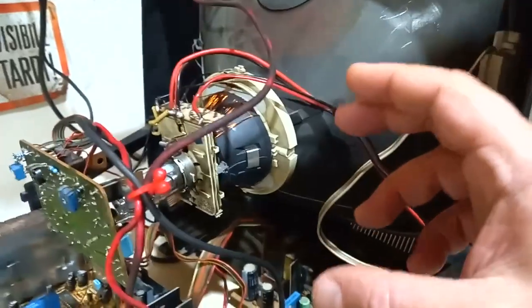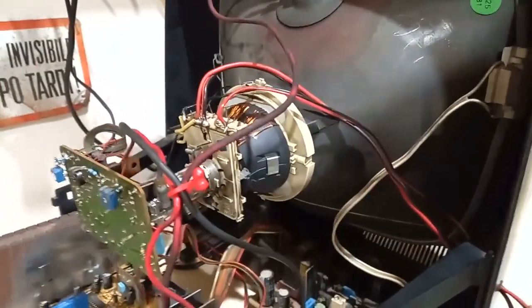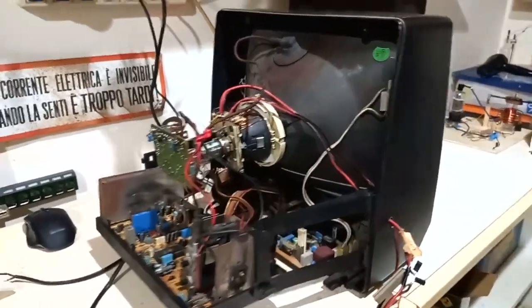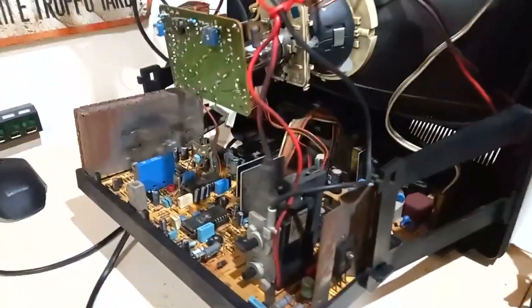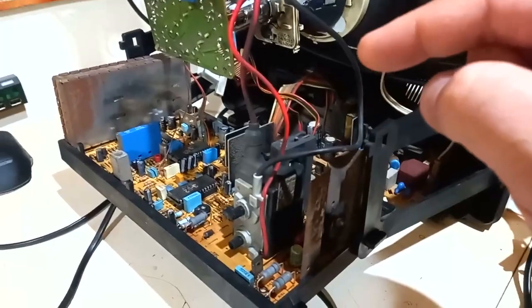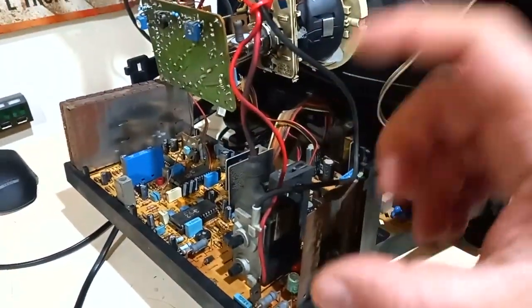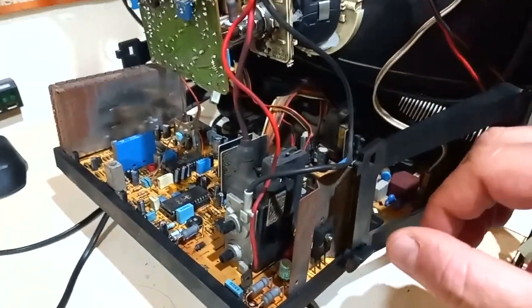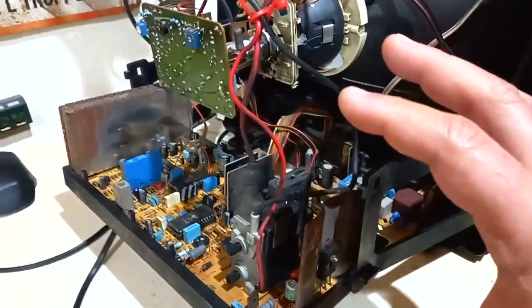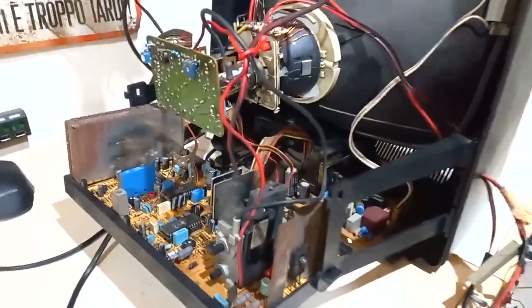This is presented as something easy, but it's not absolutely easy, because some TVs — like this one here — that is not a late-style CRT, still have protection systems on the circuit. When you disconnect the deflection coil, the circuit knows it and shuts down completely. So you have to do a pair of tricks to let the system run completely, and I'm going to show you this also.